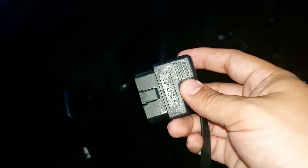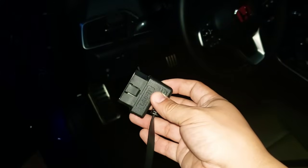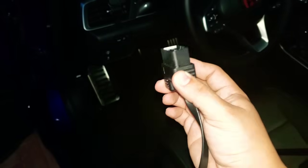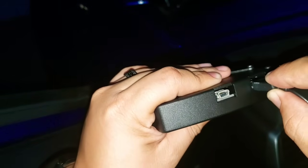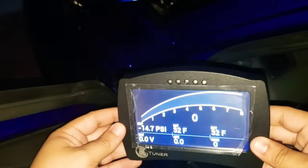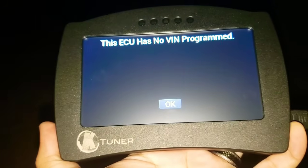This is the connection you'll be connecting to the OBD2 port of the car. The connector is located below this area — there's going to be a white connector. You connect this and it only goes in one orientation, with the clip facing the pedals. Go ahead and connect it, then connect the other side to the K-Tuner to marry it. Take this connection — it only goes in one way, so just align everything perfectly. Now it's on. All we have to do is marry it, which locks this unit to your ECU so nobody else can use it.